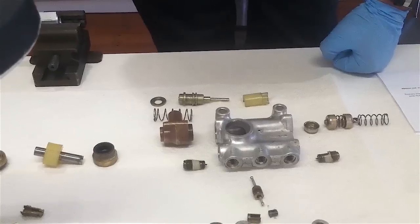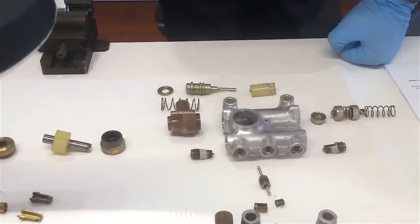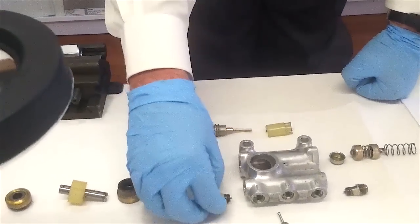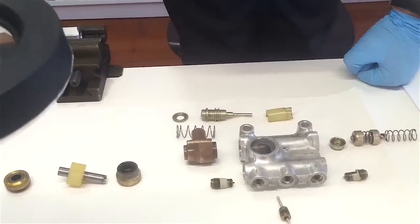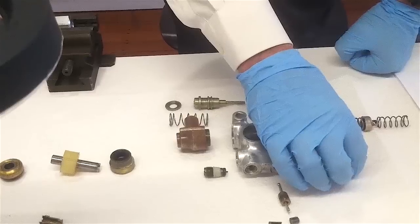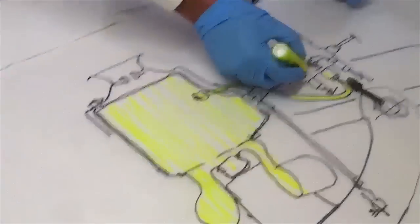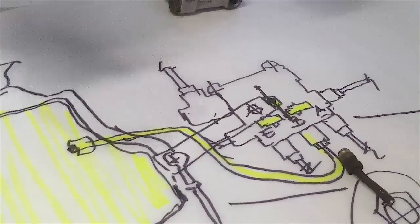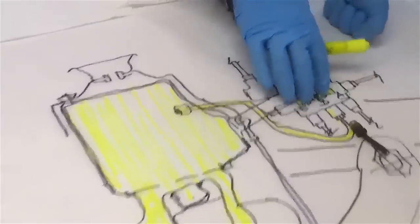Typically the bellow and the airlines are airtight. If your bellow has a leak, it is very obvious — you will hear it and clearly find out. But if these little valves leak inside, it's pretty hard to figure out. You can spray them while the valve is still in the car and you will find bubbles, but it's sometimes really hard to find. Any of these three valves leaking — the E valve (intake), the A valve (exhaust), or the toggle STK — will bring your car down. The A valve is typically in good shape; the problem is mostly the intake valve with its little check valve inside.